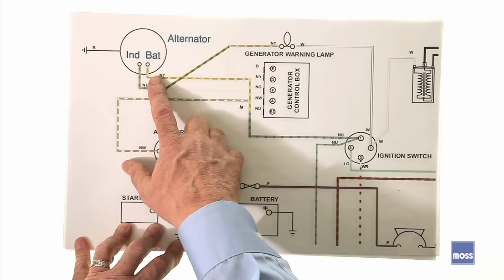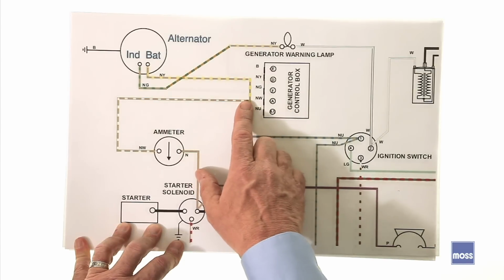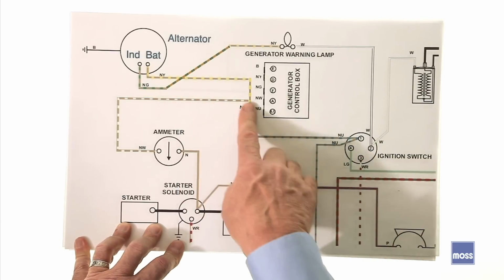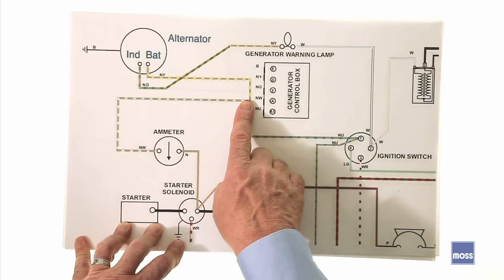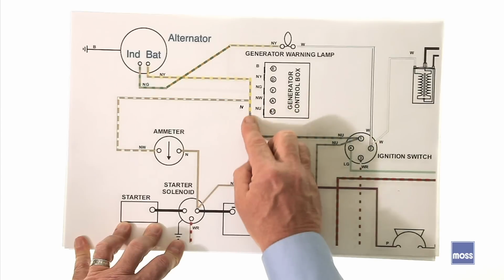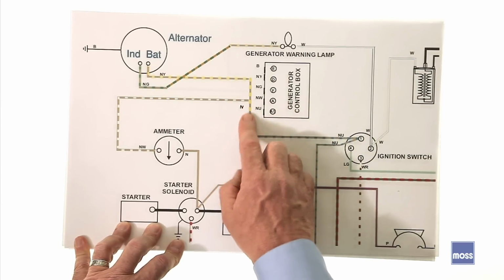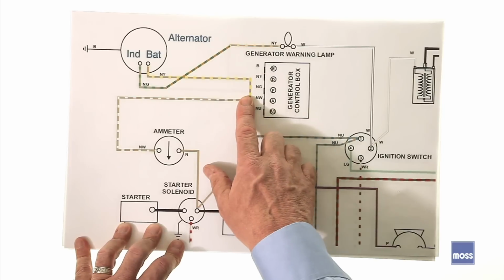The alternator now has one more large terminal coming out. This is the large wire coming down. I need to feed my battery. I need to feed the systems in the car that want current. So we marry these together to the one lead coming out. Or if there's a few different brown leads here, we marry them all together. They all do the same thing. They're all going to need current. We marry them there. And when we've done that, that's it.